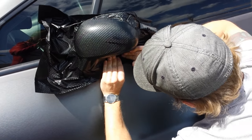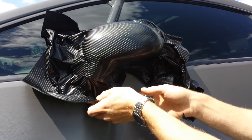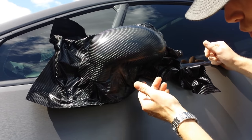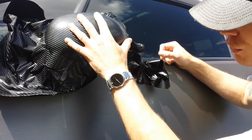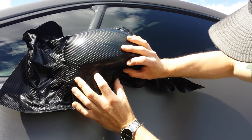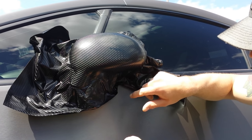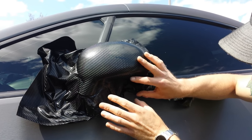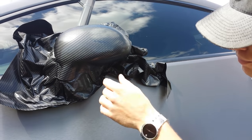We're going to end up cutting a piece off the bottom and then piecing another piece on the bottom. If your mirrors are already black you may not do it — it depends on how picky you are. Vinyl doesn't like sticking to itself very well. If you put this piece over afterwards, yes it'll have an edge facing the wind, but it most likely will never lift as long as you give it a good post heat and melt that adhesive. But if you wrap this piece over the piece that's already there and you don't do it properly, it could lift off the vinyl itself. So from my experience, other shops will tell you otherwise, but you want to do it this way.